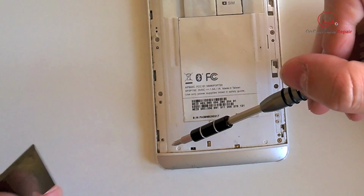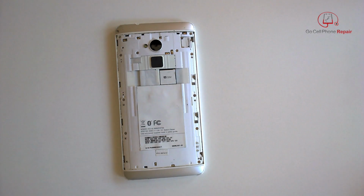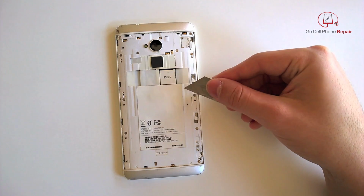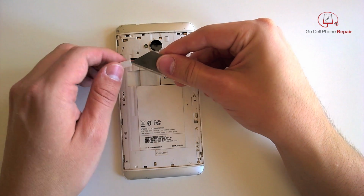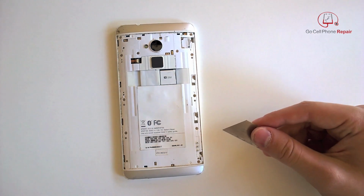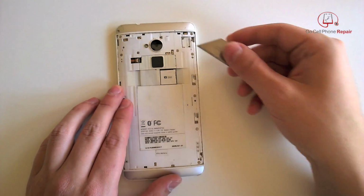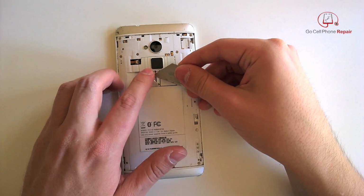Down there at the bottom left, there's another sticker that covers the screw. So sit back and get comfortable. This is not an easy repair. It's just very complex, which again is pretty typical of HTC. We've got a sticker up here that actually hides a flat flexible cable, so we're going to open up this gate very carefully. I recommend you use a soft tool rather than a razor blade, again, unless you've got quite a bit of experience.